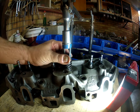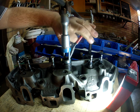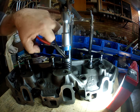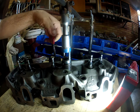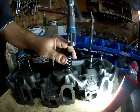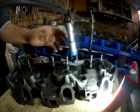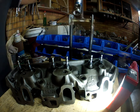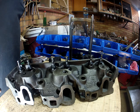These heads were reconditioned about five thousand k's ago, and now the whole engine is being rebuilt. The reason why I'm not just putting them back is there's a lot of carbon buildup from the engine. I could have just cleaned the valves and put it back, however I'm doing a bit of a cleanup on the ports, as these ports out of the factory are absolutely horrible - old-fashioned motor with a few upgrades over the years. There's so much horsepower being thrown away and fuel efficiency lost that it's not funny, so we will improve on that and hopefully I'll be making a video on that as well. We can now flip this over and turn the head around to remove the valves. Hope you've enjoyed that - thanks for watching.